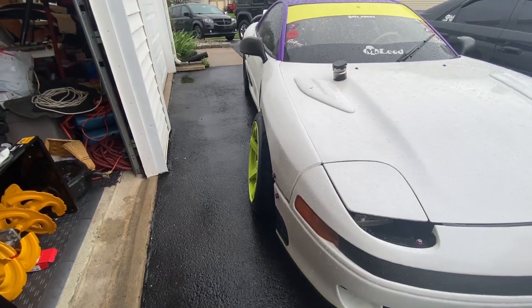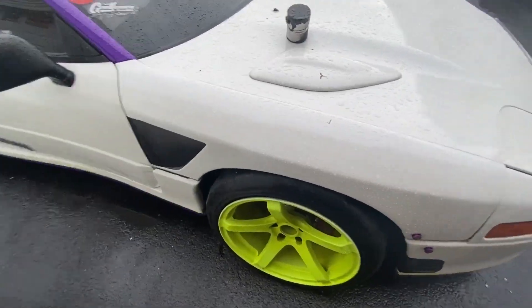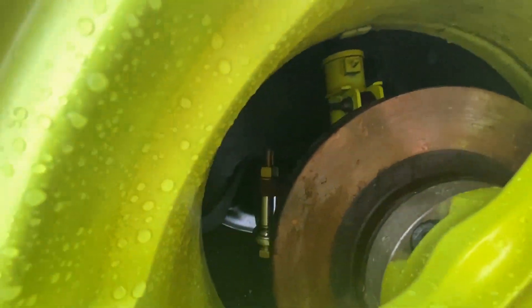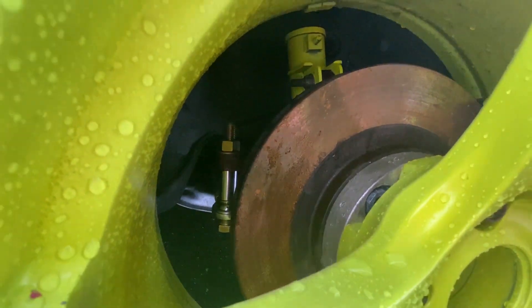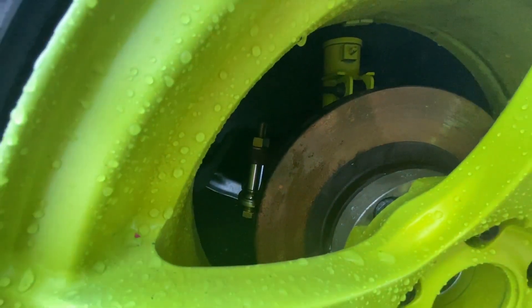All the hardware to connect the outer heim to the knuckle came from Lowe's - easy to get. I'll explain what I got in the description. With some measuring, finding the right inner piece, and getting the outer heim connected to the knuckle, the rest is just finding the correct length of tube. It'll give you bump steer correction and something a lot tougher than the factory tie rods. With the wheel on fully compressed, that's the maximum toe out I'll be able to run - the arm appears to be perfectly straight coming out of the steering rack.